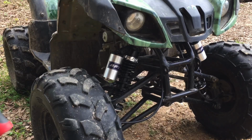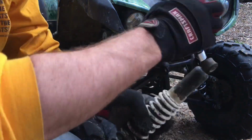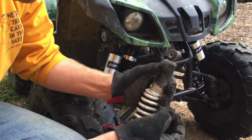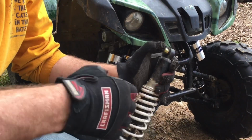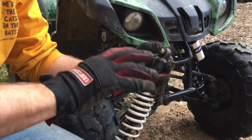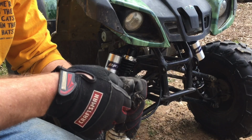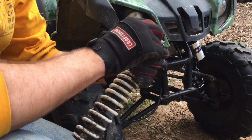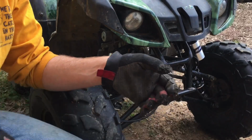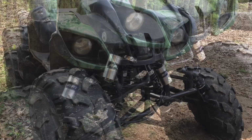I think I did this whole video without any editing, but I will edit in a shot maybe here in a second, or maybe I've already edited in, of an easy way to push these shims out. You just basically take a socket, your new shim, put it in a vise. And if you don't own a vise and you're doing stuff like this, just go buy a vise. You can get a cheap one. Craigslist, Marketplace, find a cheap one. But you just press it and you use mechanical advantage. You push that out and that one seats in and you're done. So there you go. New shocks.